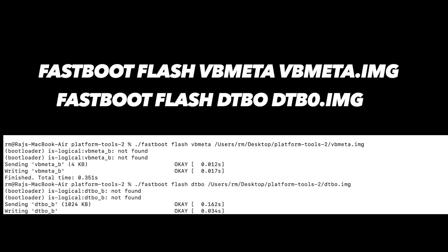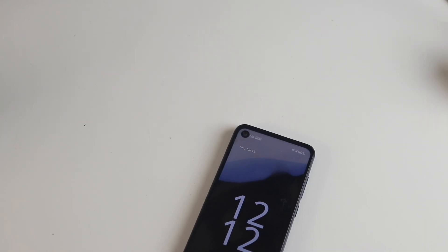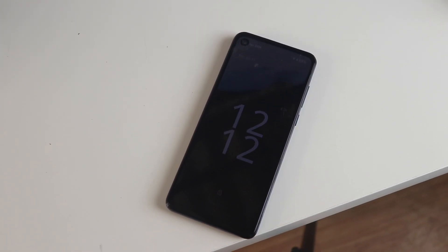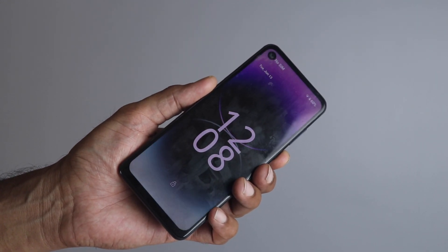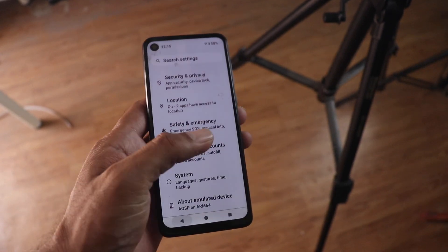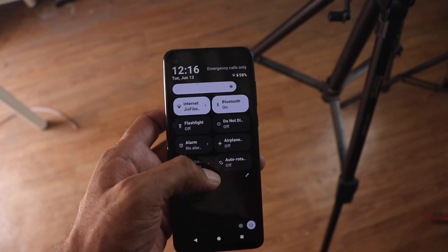For the rest I used the fastboot method. I installed a couple of files just to make sure there's no issue in terms of booting the device, and finally flashed the system itself — the GSI image — and that's pretty much it. The instructions are pretty much the same for flashing a GSI ROM on any Project Treble device, however you need to make a few changes as per your device's partitions. This video was just meant to showcase Android 14 on such an old device. Anyway, that's been it for this quick video guys — thanks for watching, like and subscribe, I'll see you soon.